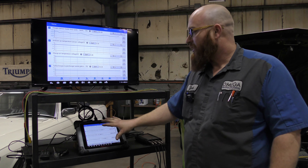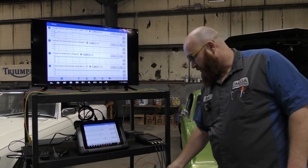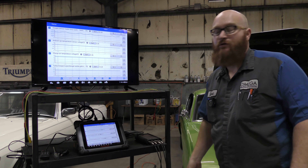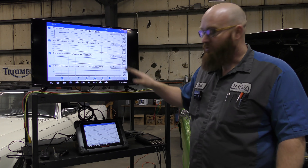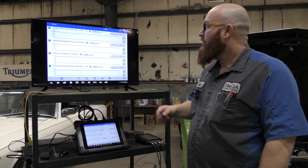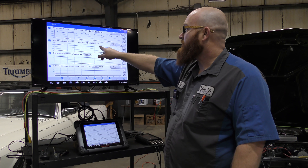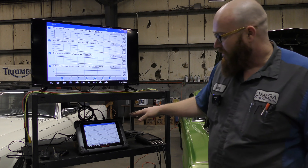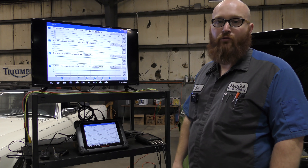When you don't have a diagnostic port but you want to see this data, you have to use an oscilloscope. And sometimes you use that even on a modern car — if you have something that doesn't have a data PID, you're going to have to hook up your oscilloscope and read it manually anyway. You can see your oxygen sensor working, the ambient temperature, sensor voltage, charge air temperature voltage, turbocharger percentage, wastegate — all that information is readily available with an OBD-II port.